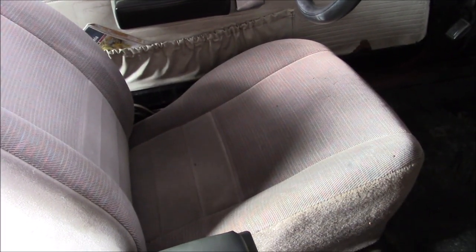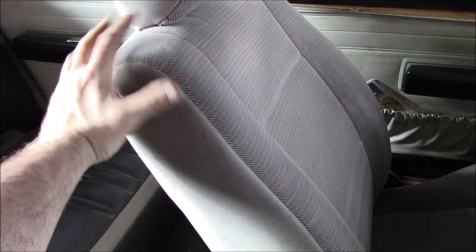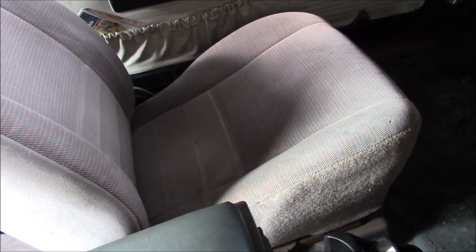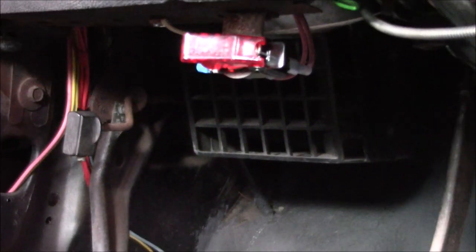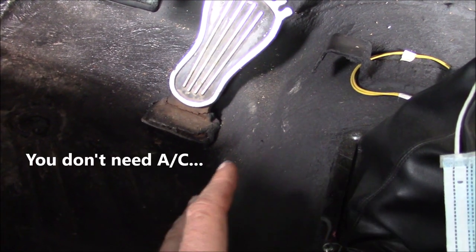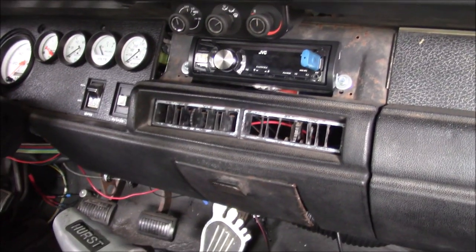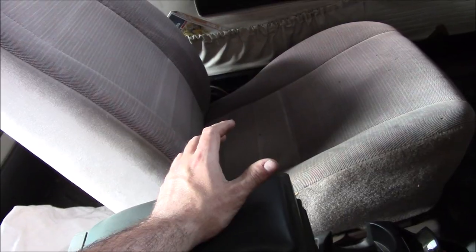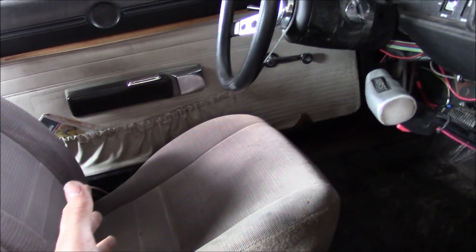Now it may not seem like much, but this upgrade has been in the works for quite a while. I built this car to be a driver. Some of those minor things that kind of bug you and make it not quite an enjoyable drive, it wears on you after a while, and the seats were one of those things. The original vinyl seats are cool, and I know the '70 had those kind of unique high-back seats, but on hours-long trips it really showed as a weak point of the car. Same thing with the ventilation system — I ended up adding two extra little manual vents to duct fresh air in when you're cruising down the highway, and I also painted the floor with ceramic Lizard Skin insulating paint to keep some of the engine bay heat out. Having some cooler airflow in the car really made it a lot more enjoyable. This car is not exactly a factory restoration, so don't worry about changing some of those little things that end up making your life a whole lot more enjoyable with a project like this. Because if you're not enjoying the car for what it is, why have it?